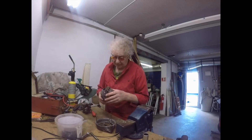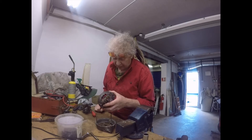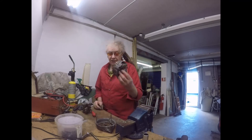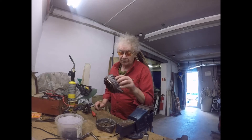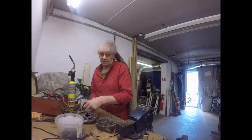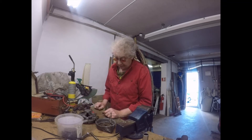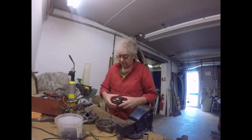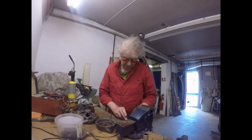It's a bit more complicated checking the stator, but to be honest you very rarely get anything go wrong with either the rotor or the stator. The main problems with alternators are bearings and diode packs — and because this alternator has an external control box which has the rectifying diodes in it, I don't expect any more problems. I'm just going to clean everything up, re-grease the bearings and re-assemble it, then test it when it's on the vehicle. Having tested the rotor and cleaned up the pole pieces on the wire brush because they were very rusty, I'm now going to re-assemble it.